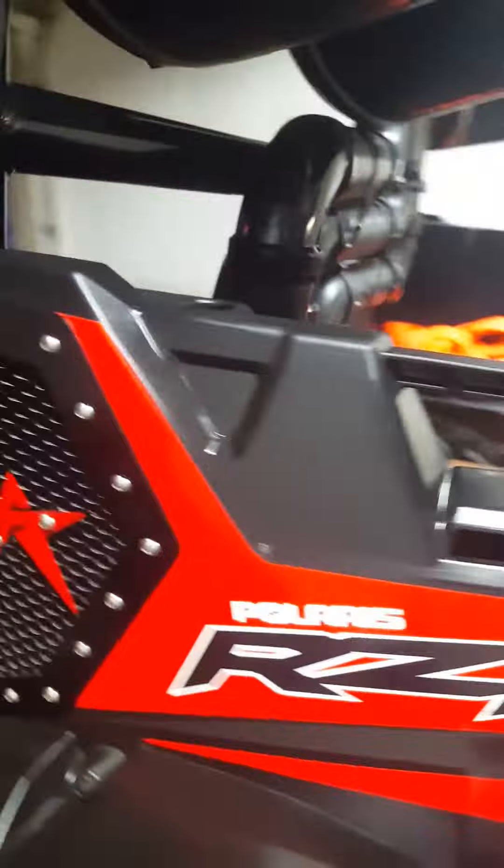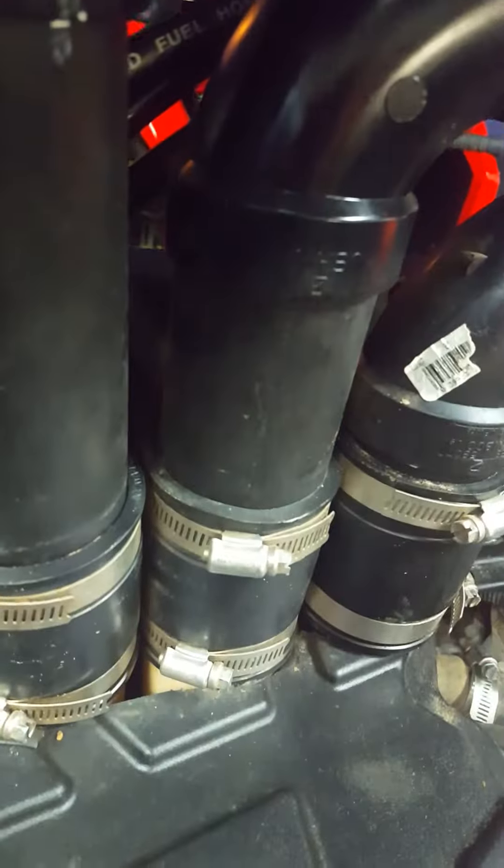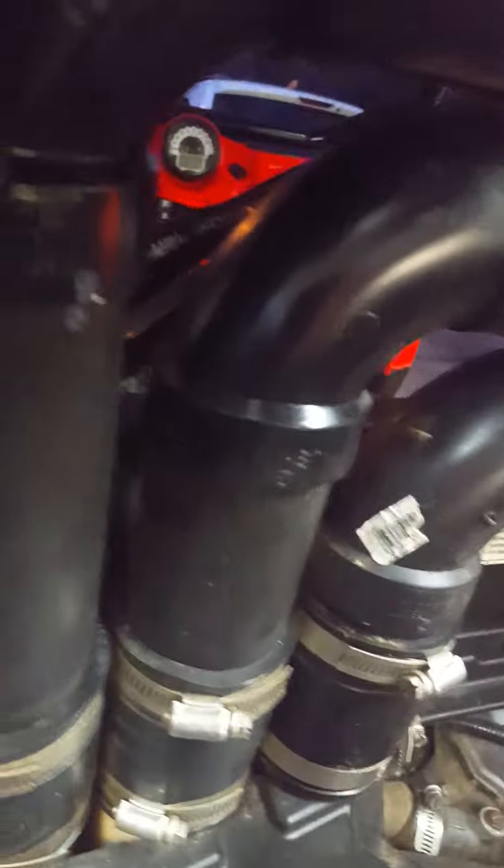For the belt intake, we did a straight two-inch to two-inch rubber coupling, then another street 45, and then underneath the bed we added a 90 to a small section of two-inch pipe, then another 90, and that goes up — and that does the center snorkel there.